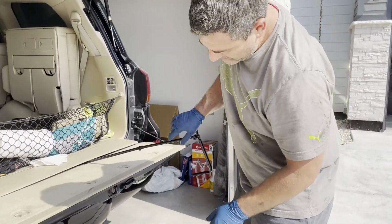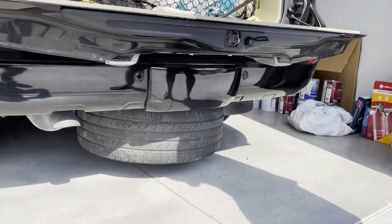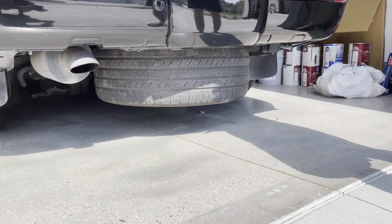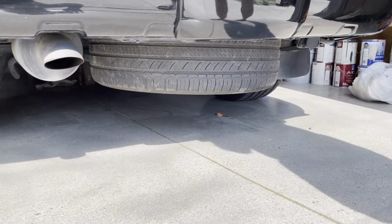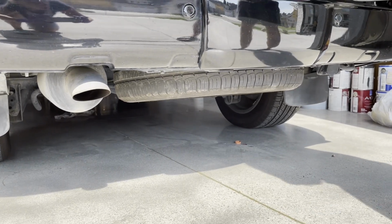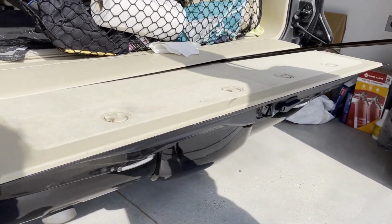All right, once you got the chain hooked in the tire, it's just a simple matter of cranking it down. Righty-tighty, lefty-loosey. So as you wind up, you'll see the tire go up under the car. If you got that bit centered in the wheel, it should hang pretty straight and go up pretty straight as well. Now I'm starting to feel some pressure here, and it's gonna tighten a little bit. Make sure that's secured up there and the spring's compressed.